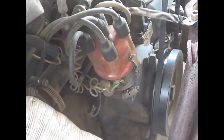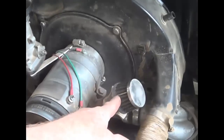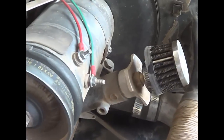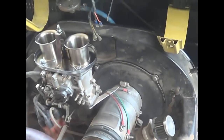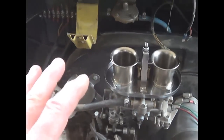I didn't do bad. All my oil leaks, I fixed my oil leaks. I'm in shock with that. I did not think that this crankcase vent, this is the only vent I'm using, and I didn't tie it into the air cleaner, I thought that'd be a dripping dribbly mess, and it isn't. Everything's dry underneath here. I'm shocked by the carburetor's performance.